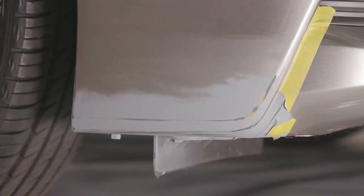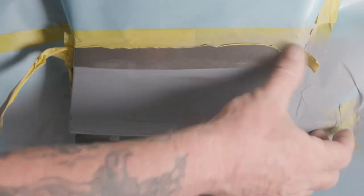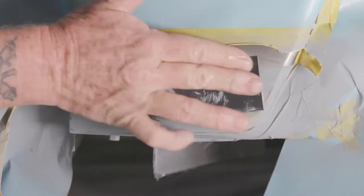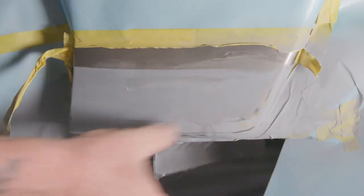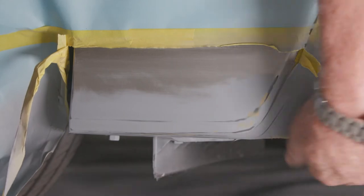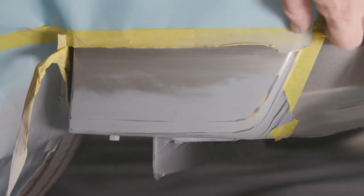Now we're going to start re-taping everything. Yeah, it's a little bit of work, but it looks great after you're done. You can take the tape off — you can see the back tape line right there — which is what we want to get nice and smooth so that you cannot feel it. You have to feather it. If you see a straight line, you need to go and feather it like this. There we go. Now we can take the tape off and clean up the surrounding areas. Once you've successfully applied your primer, you're now ready to prep it for color.